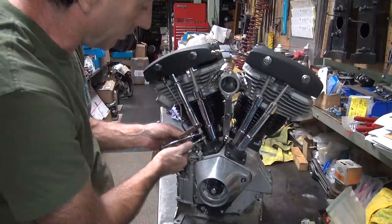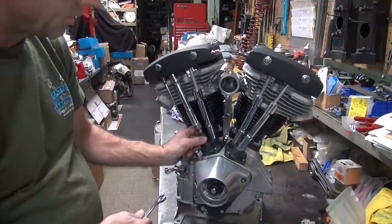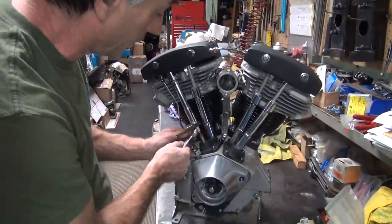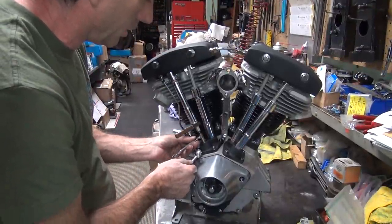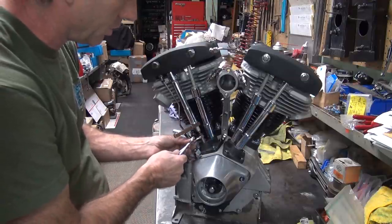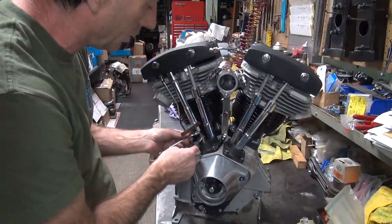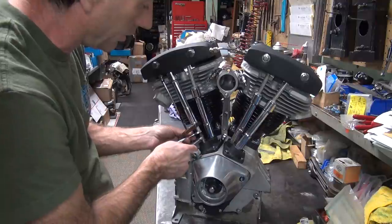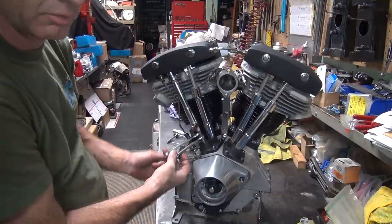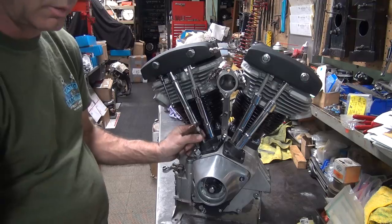Let me kind of play around with this to see what we want. This is solids, so there's no hydraulic going on here. If it's tight, it's tight. So put a little tension on the jam nut again. Quite a ways actually. Okay, I'm going to loosen, tighten the wrench. So you adjust the wrenches, you just squeeze them. You make your adjustments, so you can do it with one hand. See how they got tight? It's got a drag on it right now.